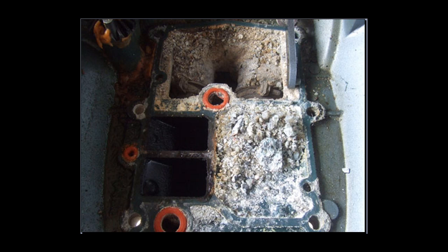Depending on the lake where you're at, use your judgement. If it's got a lot of pumice and grit in it, give it a flush. If it's nice clean water, then obviously you don't need to. But if you're running it in salt water in the ocean, definitely flush the engine for a good period of time afterwards to clean the engine out.